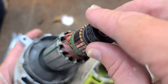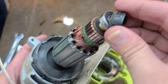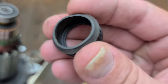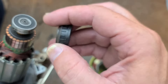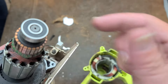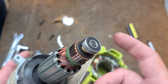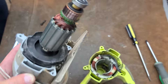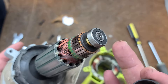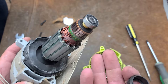Something to be said about all the old cast metal, all-metal housings is the fact that they tend to keep screws tight. When you have plastic, over time the plastic has what's known as creep — it starts to get smooshed a little bit under the head of the screw and then the screw loses its tightness. So you periodically have to go and double check. All three of these screws were definitely not tight enough, and they're even trying to mitigate that by having these extra-wide washers. It seems since the 2000s there started being more common — these little rubber grommets that go around these back bearings. We can see that Ryobi properly did a rubber-sealed back bearing. These back bearings are the most likely to actually seize and lock up because they don't have the advantage of having a little bit of a grease reservoir at the gearbox end. This one's still great — it is a 608, the world's most common size skateboard wheel bearing or roller blade bearing.